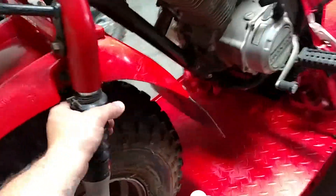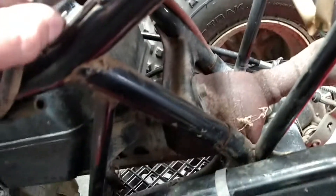Just try to look and see if anything sticks out at you. I try to look for tape, miscellaneous drywall screws — things that tell you that the person was not mechanically inclined and just did whatever they could to throw it together for another ride. Next thing you do is pull the seat off, then pull the plastics off. It's amazing, even the seat paint looks good. Looks like they filled small cracks with some epoxy or something — no big deal. When you get the plastic off, you can really get an idea of the condition of the frame.